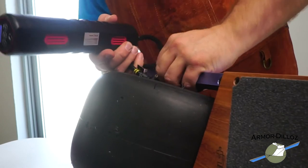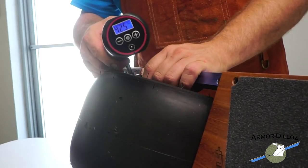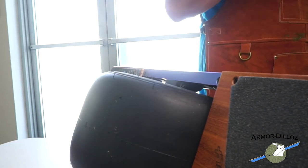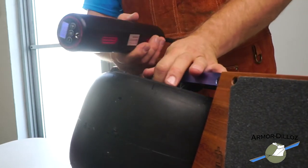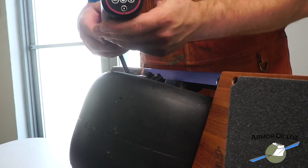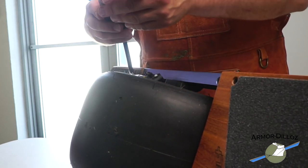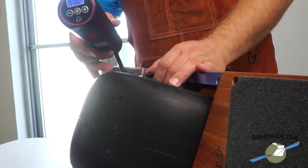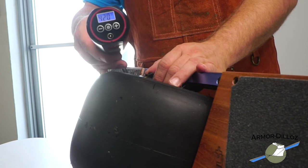Retest it again, it went to 44.5. 44.5. Okay. That could be whenever you put it on and off, it goes down every time. You're leaking air as you put it on and off, so that does not surprise me. Now, matter of fact, we'll bring it back up to 45. Because again, every time we do that, what are we at now? 40. So yeah, just taking this on and off, we lost 5 PSI.